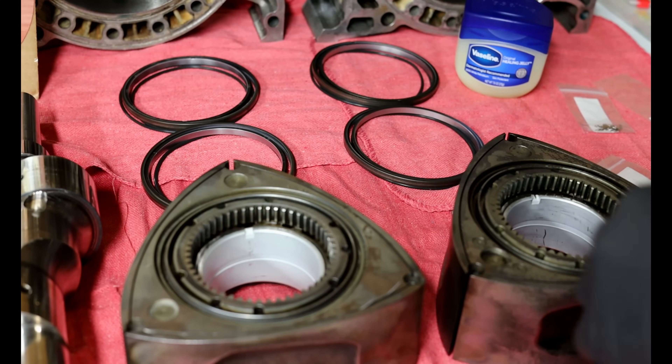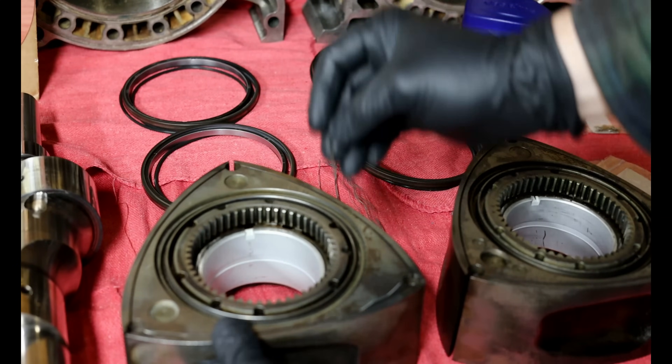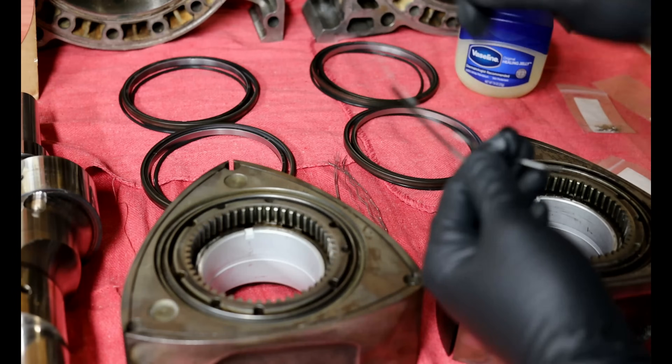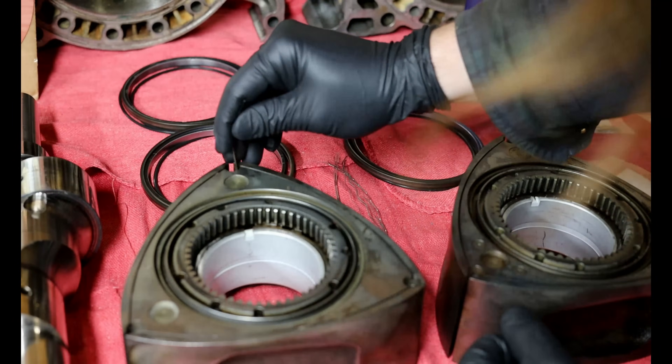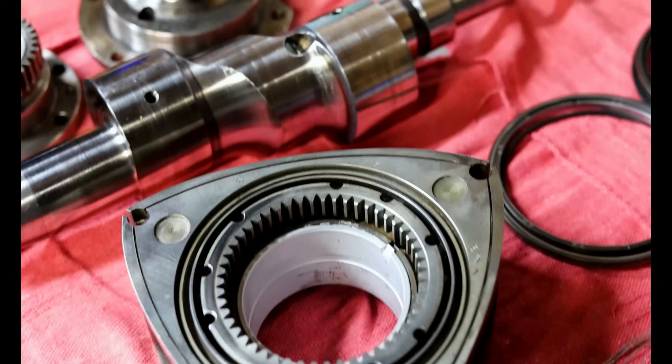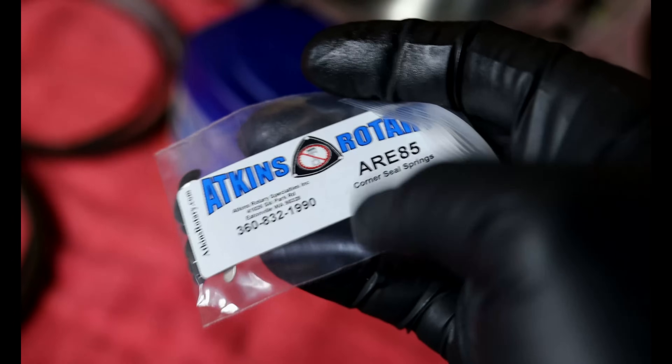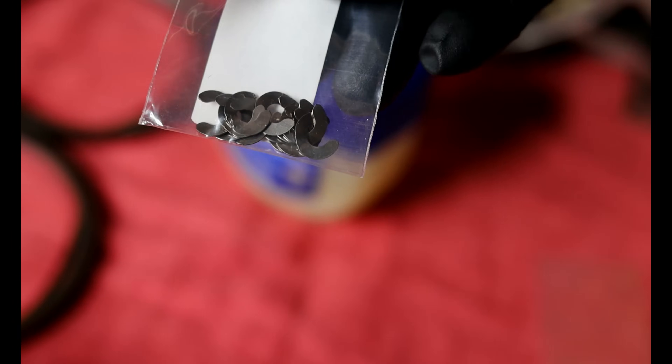What I'm going to do to help me push these things along is I'm going to use an old Apex seal spring to push all this stuff in. So now I've got all six side seal springs in. Now I'm going to take these, which are the Atkins corner seal springs — these are the fatter style. So we're going to put these in, then put the corner seals in and the side seals in.